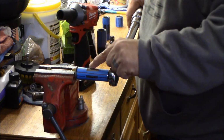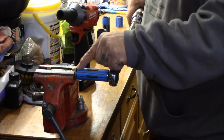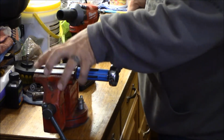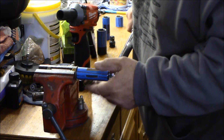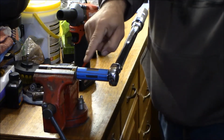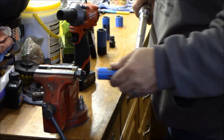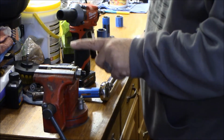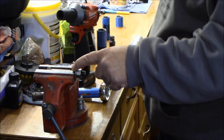What I'm looking for is the lines that I have on my socket here compared to where they are on the washer, to see if this moves. I'm not really concerned with this whole big movement. Okay, so I moved that nut just a hair before it clicked. So again, this is 30. This was not as tight as 30, so we're going to say there's no change there.